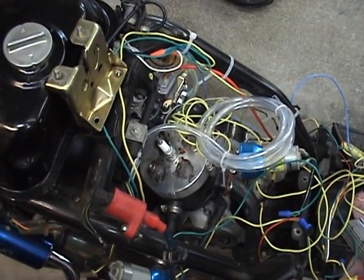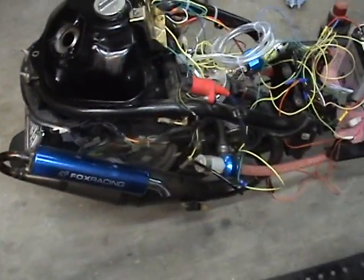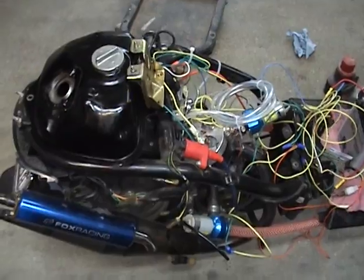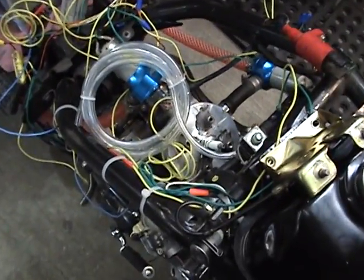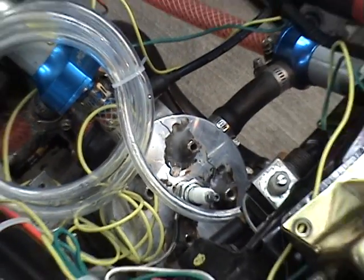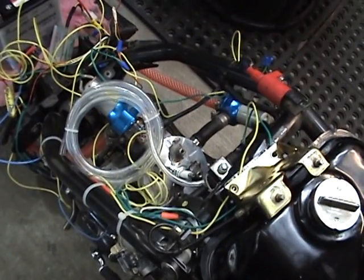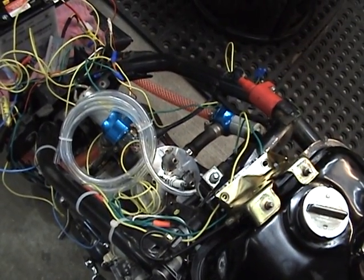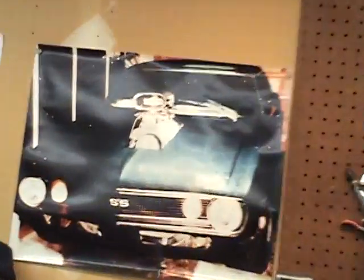Therefore, to fool a smaller engine into thinking it's a larger engine, you want to put more fuel and more air into that cylinder or into that engine. That's where supercharging comes into effect. You overpressure the cylinder and you create more air, which creates a bigger bang, which in the theory of horsepower, you've added more air and more fuel to the engine and create more horsepower.